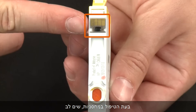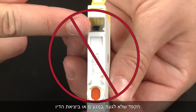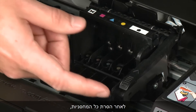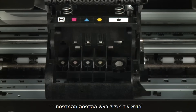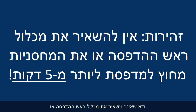When handling the cartridges, be aware of the electrical contacts and ink port. Be careful not to touch the contacts or ink port because touching these can cause clogs, ink failure, and poor electrical connections. Once all cartridges are removed, you can lift the latch handle on the carriage. Lift the printhead assembly out of the printer. Make sure that you do not leave the printhead assembly or the cartridges out of the printer for longer than five minutes. Leaving them out for an extended period of time can dry up the ink ports on the cartridges or nozzles on the printhead assembly.